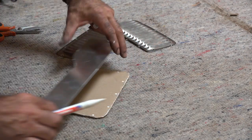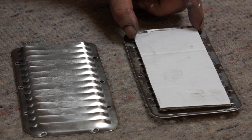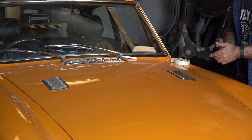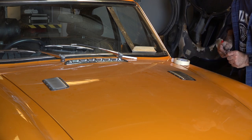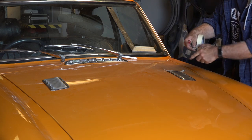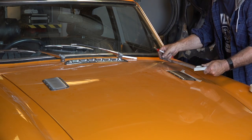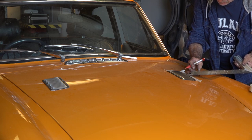This is going to be our template for the hole I will cut in the bonnet — I want ample material all around it. Before cutting the spare bonnet I want to present it on the car to see where I want to fit them. I think this is about right, so I'm going to mark this as a reference. I only need to mark one side because I'll make it parallel. That's about 20 from the top and about 10 from the middle.